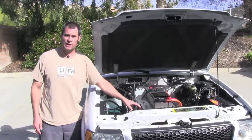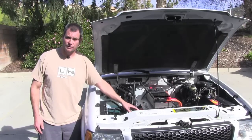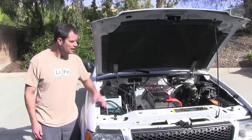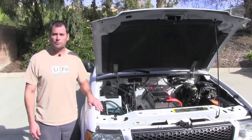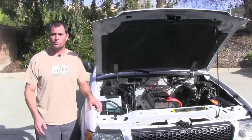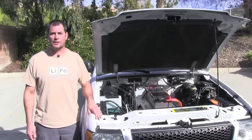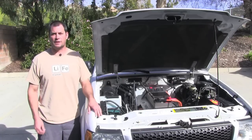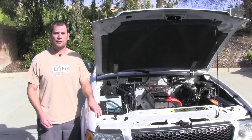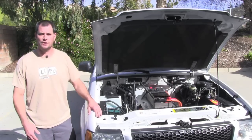In front of that we have our EV West adapter plate and pump system. We have a factory air conditioning pump so we still have our air conditioning in the truck. In the middle there we have a belt driven vacuum pump — we really like it, it creates plenty of vacuum and it's a nice quiet running pump. On the far right we have our KRC power steering pump, another item we really like. It has an interchangeable valve system that allows you to control the volume of the power steering pump, making it really universal — anything from a small light sports car to a heavy duty truck.